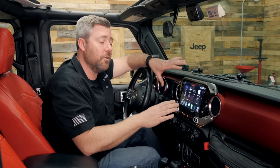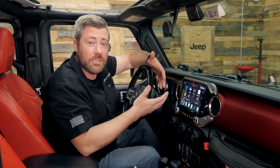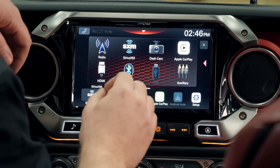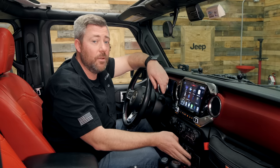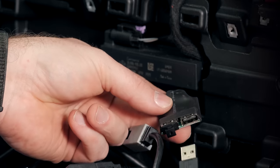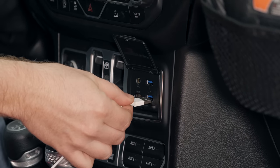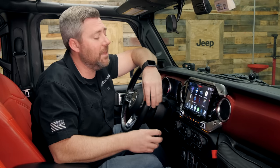We've got Bluetooth audio capability so we can use hands-free calling or stream music over Bluetooth. We also have auxiliary inputs like USB and a 3.5mm jack, and even an HDMI input — all handled right here on the replacement bezel included with the i509 that takes the place of the factory unit. This gives you the HDMI input, the 3.5mm auxiliary input, and two USB ports. One USB port is a dedicated charging-only port with no data connectivity; the other is dedicated for Android Auto and Apple CarPlay wired connection. When you install the i509, you'll also retain charging capability for the USBs found in your center console and rear seats.